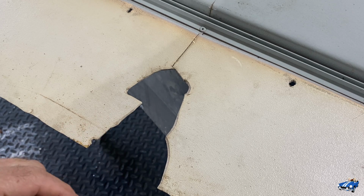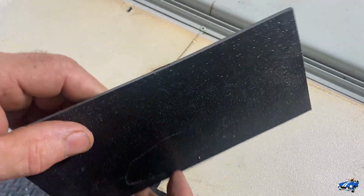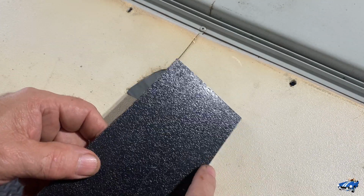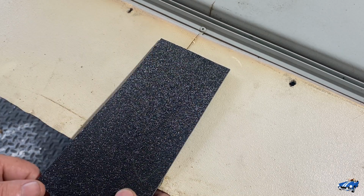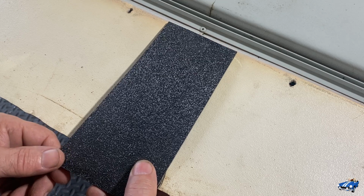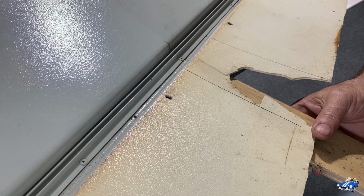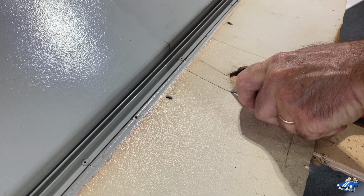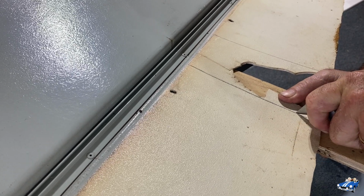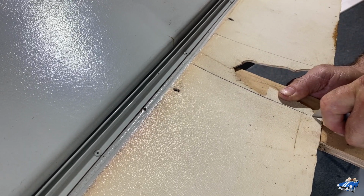The big crack in the back here. Obviously there's nothing left to glue together on this thing, so I do a little hobby vacuum forming, and I had a piece of this black ABS plastic, and if you notice, it very similarly matches the grain of the original piece. So what I'm going to do is mount this here, cut the original piece out, epoxy it in, and then try to clean up the edges. I think structurally it'll probably be strong enough and hopefully will match well enough that when I'm done with it you really can't tell. Stuff cuts fairly easy, not super, but.